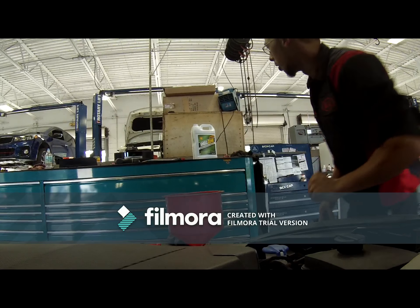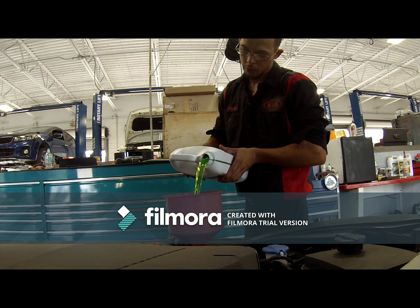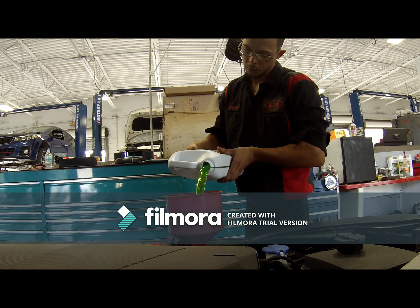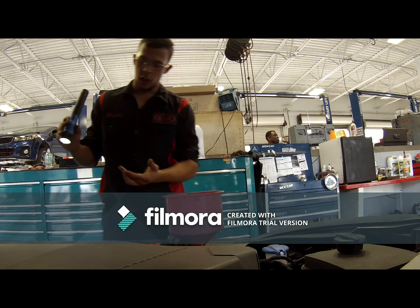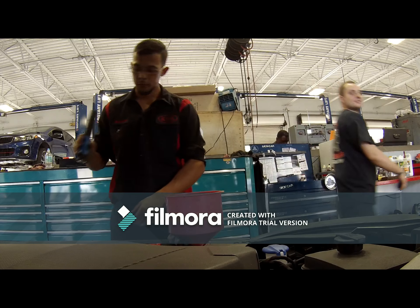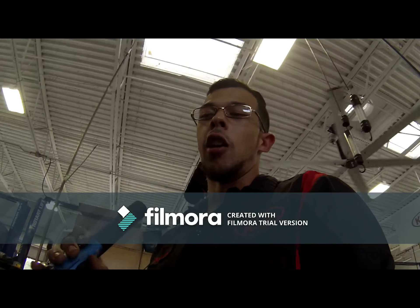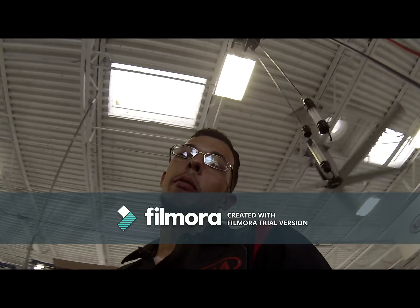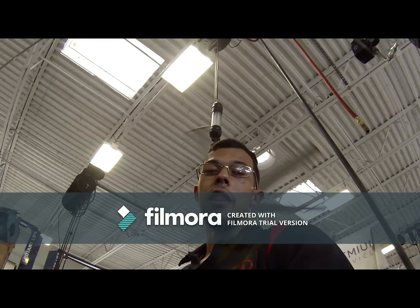Once you've had all that done, double check to make sure you have no leaks. Most likely there wouldn't be any until the system gets pressure. Make sure you get all the air out of the system — start it and let it bubble out, takes usually about 15 minutes or so. I have the pleasure of hooking a computer up to this so I know when it's ready. For those of you who don't, just make sure the bottom hose is hot, the top hose is also hot, and the fan has come on at least one time. If you guys have any problems or questions, go ahead and send me a message or write a comment and I'll make sure and reply. Thank you for coming to the channel.